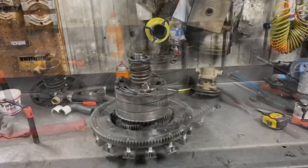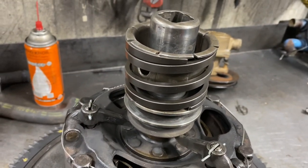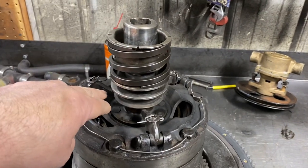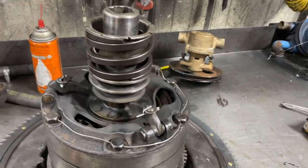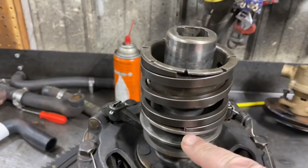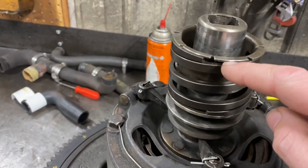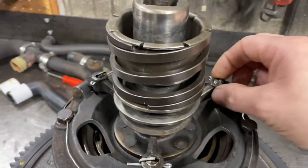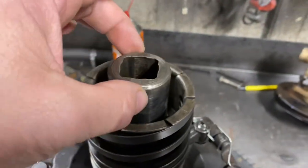The last thing I want to show you is how I adjusted the spring. This spring is keeping tension against the direct clutch. Right now in the finished state, before it goes on the engine, everything is locked up — that's the way it should be because when those fingers are down all the way, this spring is pushing against the direct clutch, which is applied or 'high.' You've got these three little screwdriver-slot screws. You want two inches from here to here, so adjust these screws with a tape measure and make sure each one has a little bit of tension — you're trying to split the tension between the three. You don't want one finger doing all the work.